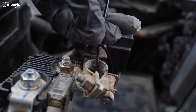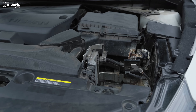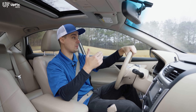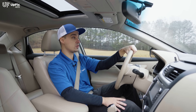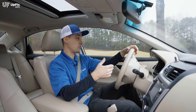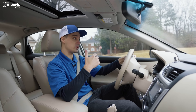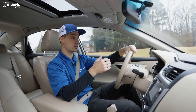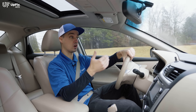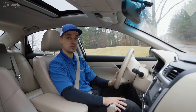When you have the two battery terminals zip tied together, grab yourself a cup of coffee, come back in about 15 to 30 minutes, and then do everything in reverse order. After the hard battery reset, this should clear up any kind of soft codes, communication, or syncing issues. Sometimes after you receive a unit back from us you might have an issue with communication or a new symptom — the first troubleshooting step we always recommend is a hard battery reset first and foremost. Then if you drive it up to 100 miles and you're still having a light come on, that very well could be a hard code and no longer a soft code, meaning there's a hard fault in the vehicle. Using an OBD2 scan tool will help you clear that up and find the issue. Hopefully you found this video helpful — we'll see you next time.